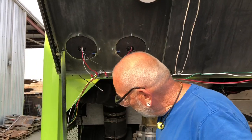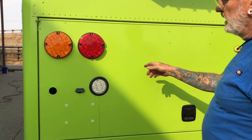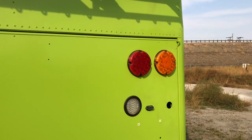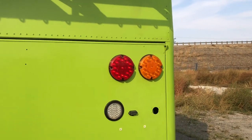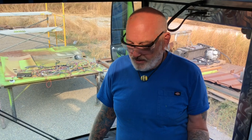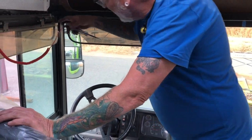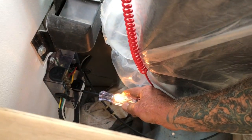I should have everything with the backup lights but they still don't blink, so I think I might need to add a resistor. Let's see if these come on - okay YouTube, we're watching. So I'm sitting up here in the driver's seat so he can go back and see what's happening, just so he can have peace of mind. The test is good - the marker lights are working. All I've got to do is hook up the backup lights, but I won't check those until we're off the jacks so I don't bust something. But the blinkers aren't blinking - I think it's because they don't have enough resistance. When I add this light to it, then they blink.